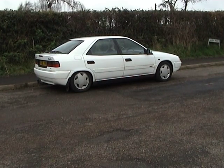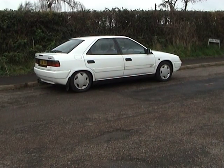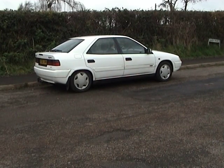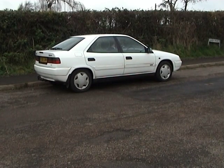The rear of the car is usually the first to come up as it's the lightest. You may notice that the front lurches up on some cars. That generally means that your front suspension rams need greasing, which I'll probably come on to in another video.